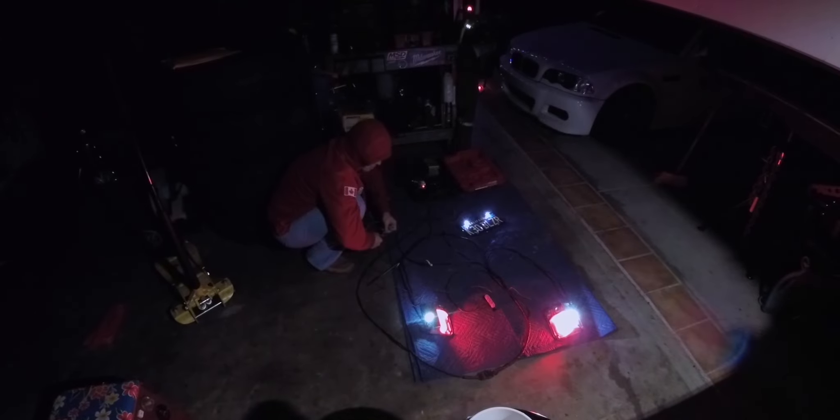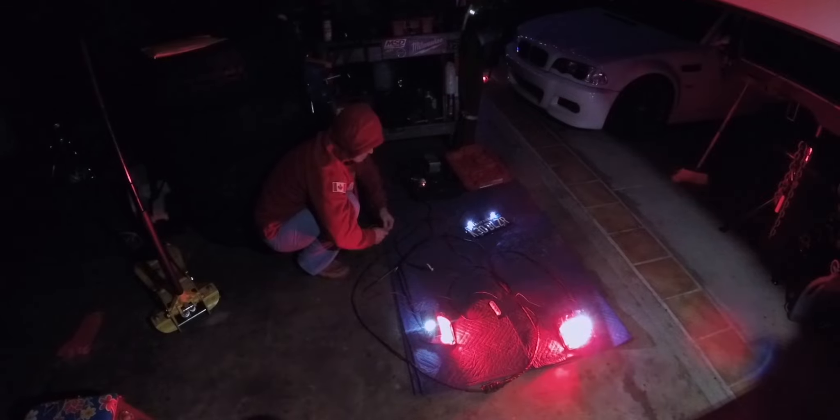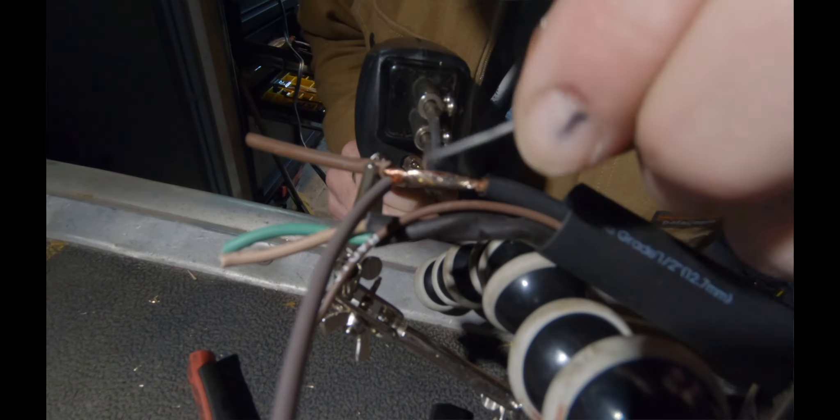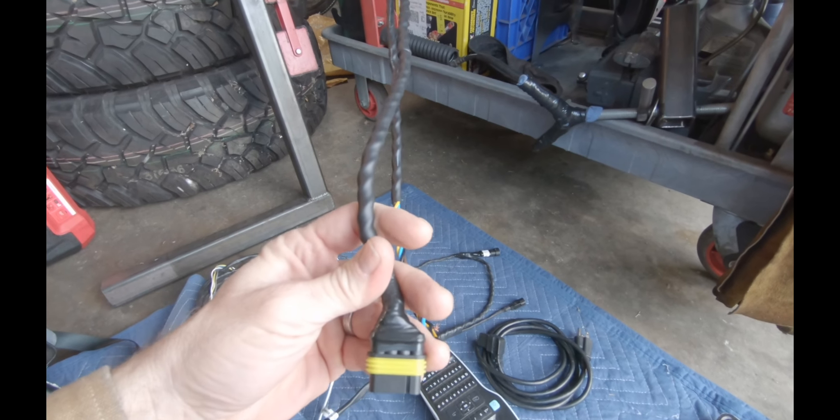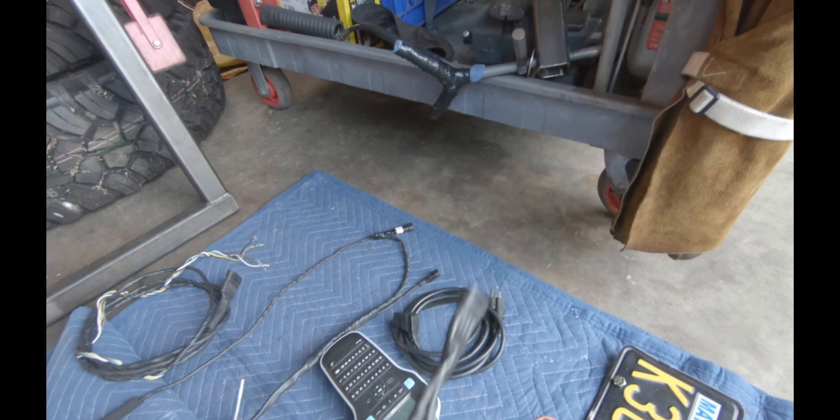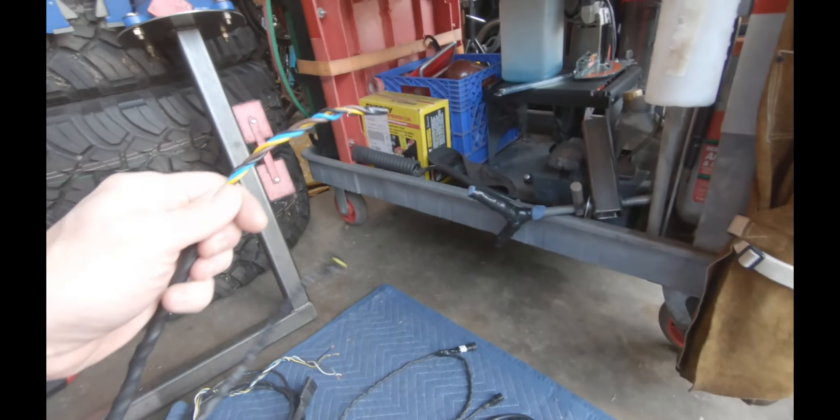I've been having a lot of progress this week. You guys have seen I got the shock tower in — that went in a lot better than I had hoped, but it's also not all the way in yet. The other thing I've mostly done is my wiring harness, and I am stoked on how this has come out. Here's my tail light — I've got brake, reverse, everything, and it terminates down to here. In this plug I'll have my ground, my brake, my reverse, all that stuff, and they just continue to plug into more of these.